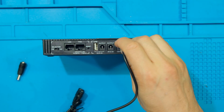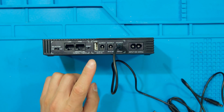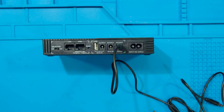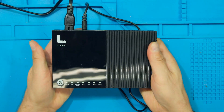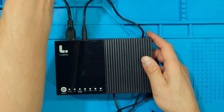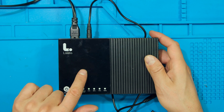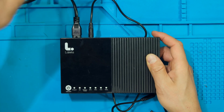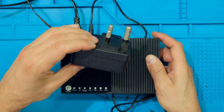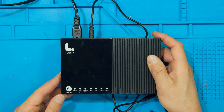Once you've chosen your output and plugged in your router or ONT box, you don't have to unplug it when the power comes on — leave it plugged in all the time. That means your router will always be on because even during load shedding or a power outage the unit runs off battery, and when the power comes back it automatically runs off mains. You don't need to plug your router back in with the AC-DC adapter — just keep it connected to this UPS going forward.